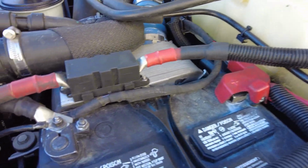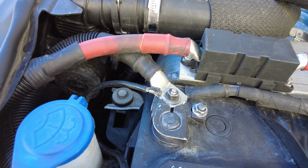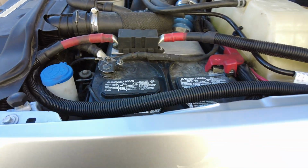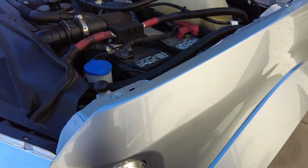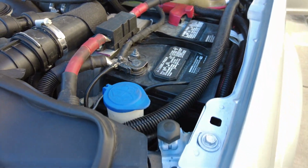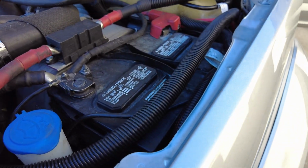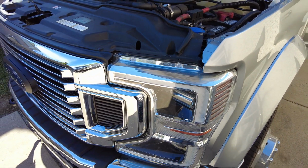Well, the problem and the issue is the wiring size. If they're going to run 12 volts to that system, then it's challenging to run the wiring. Now, if they could step the voltage up with some kind of a device that can change the voltage, to like 24 volts or 48 volts just to make that run back, then it would be a lot easier for the system to run higher voltage inverters. But the inverters themselves, they don't cost that much.